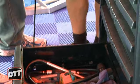Yeah, because you guys pull the fuel out and measure the fuel, see what your fuel loads are. Yeah, you don't want to run a full tank, but you want to run the right amount plus a couple liters. So the Yamaha guys, I ask them what they run, and they tell me, and we kind of bounce it off each other, getting about 0.52 liter a lap. Then you multiply that by 26 laps, counting the pre-laps and the post-laps. Say, okay, plus two, and that's where you get your liters for doing the race and not running out. Key: not running out.